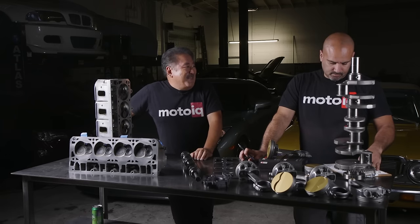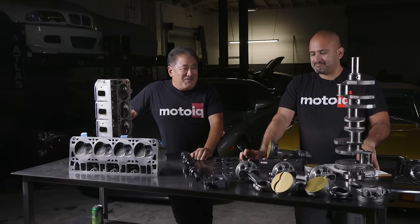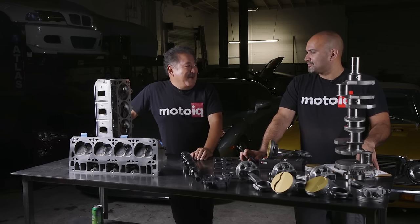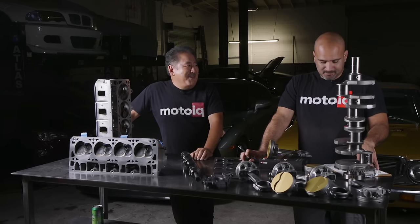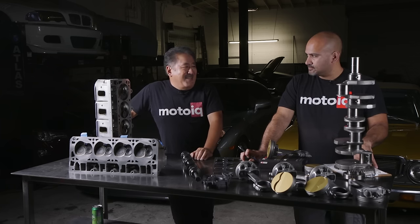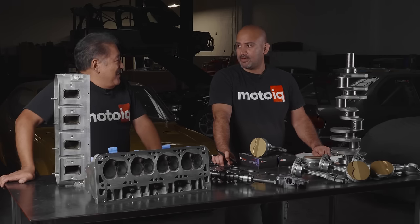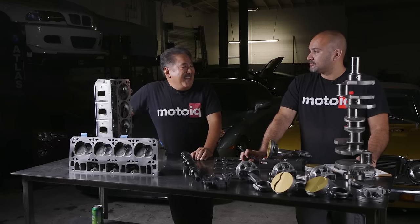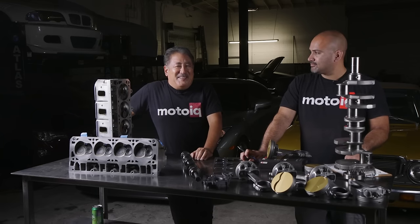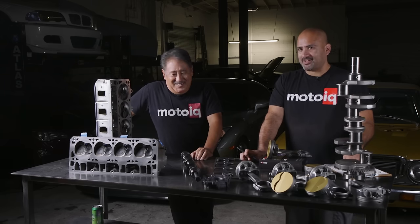That's important for extreme use — drifting, road racing, boat motors, high RPM situations. A boat motor is a severe case: the engine's at full load, full send all the time, and when the boat bounces and the prop comes out of the water, the revs shoot to the moon, bounce off the rev limiter, then come back down with enormous stress. Drag racing is almost nothing because it's only a few seconds. Road racing you're on the throttle for minutes; Bonneville for minutes. Road racing the engine has to hold up for maybe a couple hours every day and do that twice a race weekend. These are serious motors that have to be well thought out. Someone on YouTube comments might say they can build an eBay motor that puts out 1,500 horsepower — but for how long? A dyno pull, a couple blasts on the street, maybe a quick freeway pull. That's not real racing, that's just screwing around.